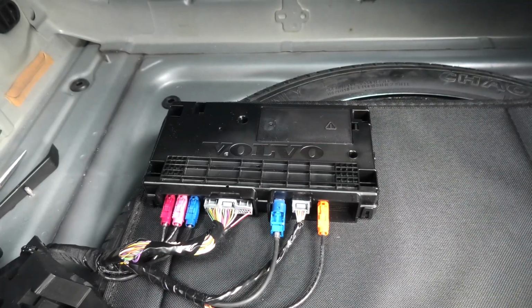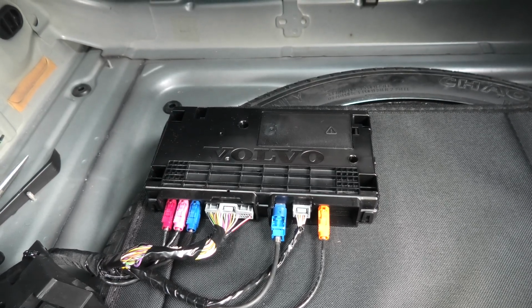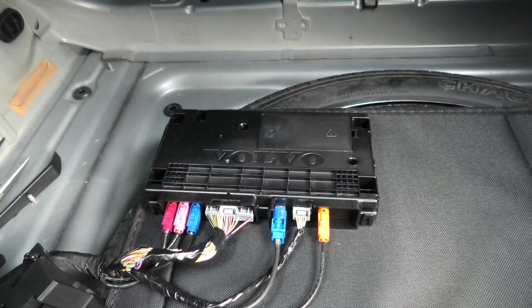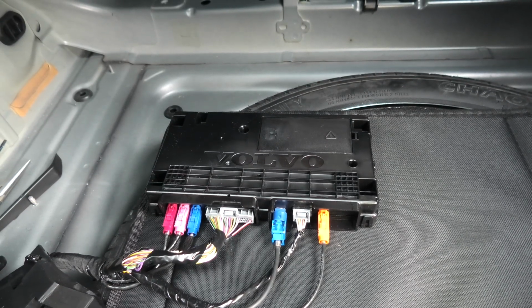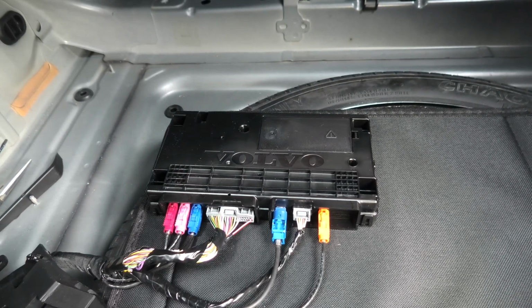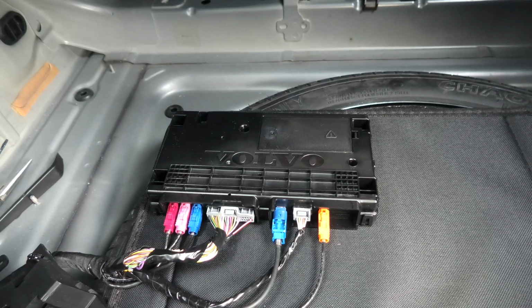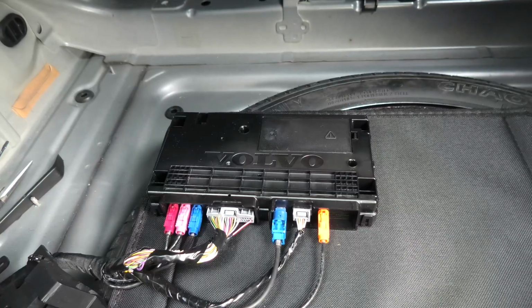The VCM module also receives the GPS or GLONASS signal to provide the position of the vehicle for the navigation system or in case of emergency. And the VCM module is also used for diagnostics. It will route the diagnostics data between the vehicle and external test equipment using CAN bus, Ethernet, WLAN and Internet.